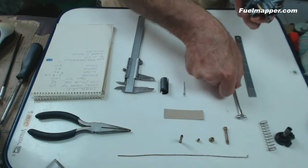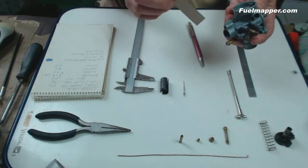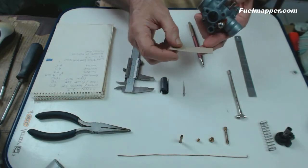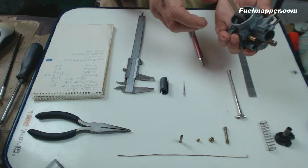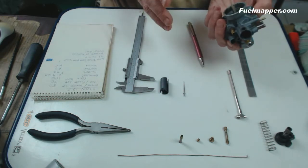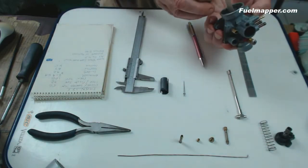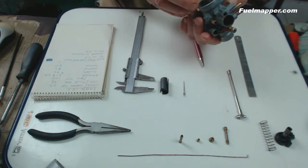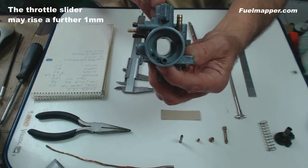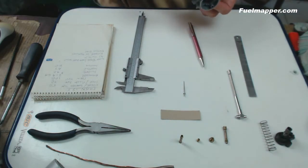If you don't have telescopic gauges, you can use a bit of cardboard. Take a guess as to how big it is and measure out a parallel strip, then just drop it in. If it's too big you'll know. Generally speaking, you'll be looking for round numbers — in this particular case it's 19mm. If you tried 20 and it won't go, try 19 and in she goes. If you want it to be perfectly accurate, you can measure how much higher it goes — probably about a millimetre — so you could log slider travel as being 20 if the carb body is 19.